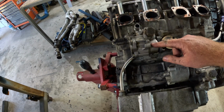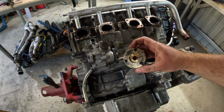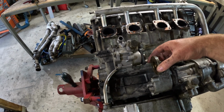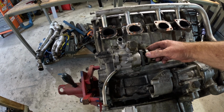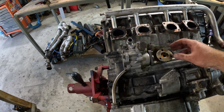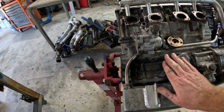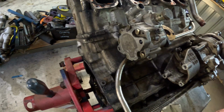Now this is the power steering pump. See here, you've got a coupler, and this actually came loose on mine. It just moved on the shaft, it moved away from the pump, and obviously the little drive pieces disengaged, and that was it, no more power steering. But imagine trying to get at this from underneath. You've got room to maybe get your fingers around here. There's really no room at all to do anything.